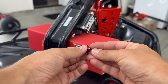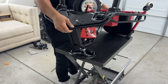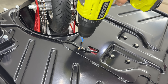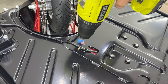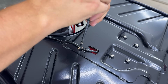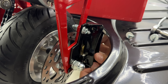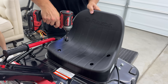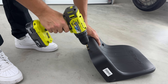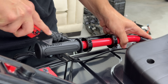Install the battery, plug it in, and screw the battery right in — it fits perfect. Steering wheel goes back on nice and tight. Flip it over to add one screw at the bottom of the battery — measure it out and mark it with tape so you're not drilling too deep. Drill into the bottom of the battery and screw in the one included screw so the battery is held down. This is what ensures you get your warranty on the battery. Flip it back over and install the brakes — very similar to a bike: install the caliper and align it, then remove the seat so you can route the cable under it. Drill two holes right near the bottom so the seat can go on with the cable running under it.